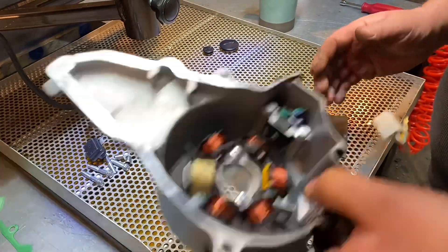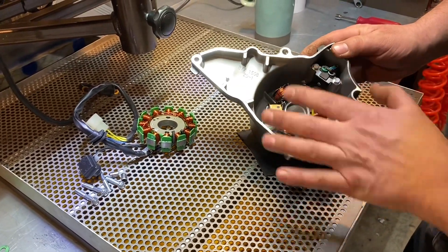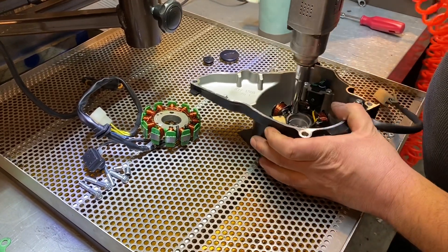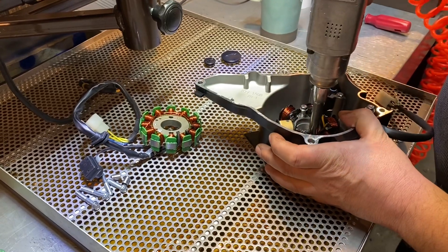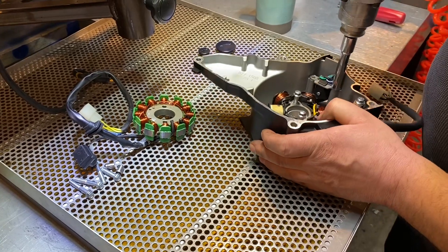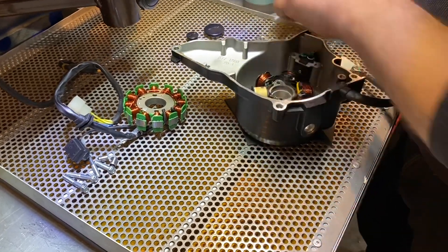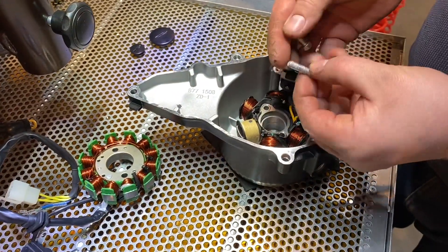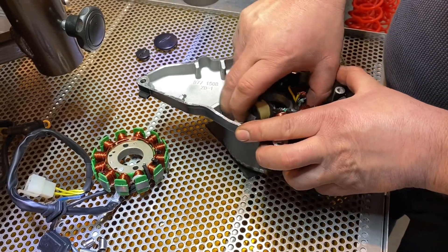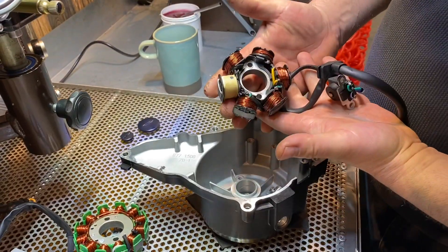Okay, fitting the coils. Use a rubber pad so we don't scratch the cover. Take the coils all out completely — everything that's in there — using the 8mm. They are Loctited from factory but you don't really need to re-Loctite them as it just ends up pulling the threads out eventually. Old coils are out and gone.